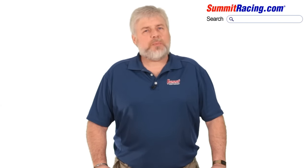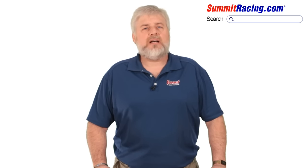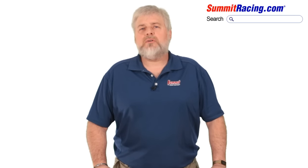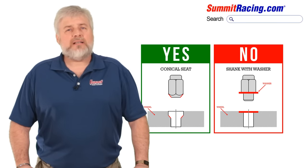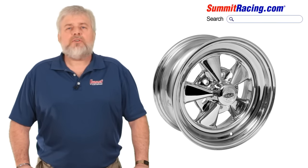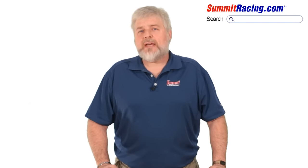A word of caution on both spacers and adapters. Because you're moving the wheels out and off the center hub, you will now be relying on your wheel studs and lug nuts to not only center the wheels, but also bear the load of the vehicle and its occupants and/or payload. The use of conical seat wheels and lug nuts is preferred. The use of aftermarket wheels with slotted mounting holes will not run true going down the road and tend to feel out of balance. Because true spacers are generally only an eighth to three-eighths of an inch thick, any material such as cast or billet aluminum or steel will suffice.